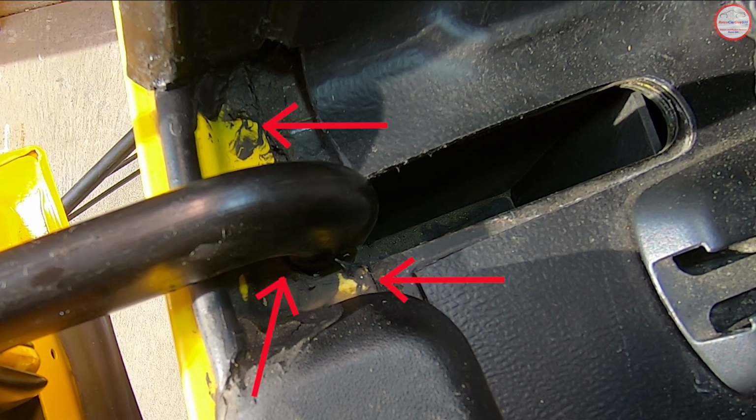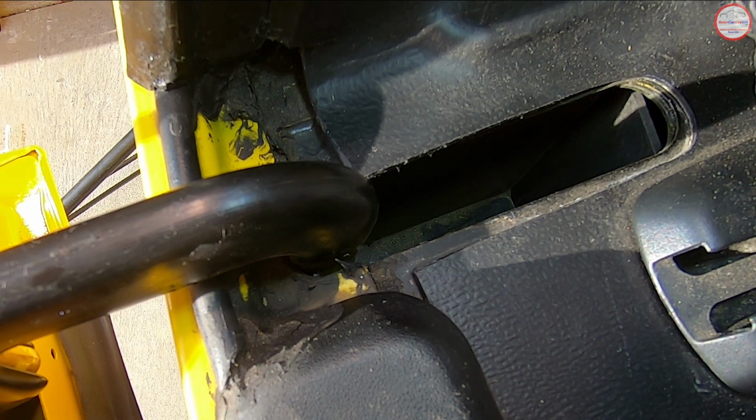And that will happen while you're driving down the road and water gets sprayed up from the tires or just naturally off the road as you're driving over it, and the wind effect from driving down the road will throw it up on the bumper cover on the back side of it, and it seems to push it up enough into the cargo bed area that this was the main source of the leak in my 2005 SSR.